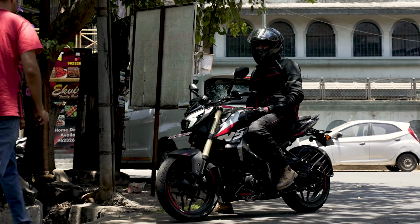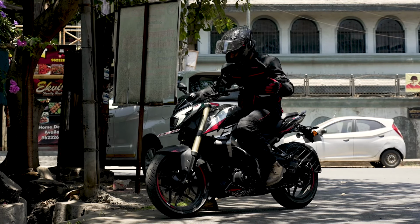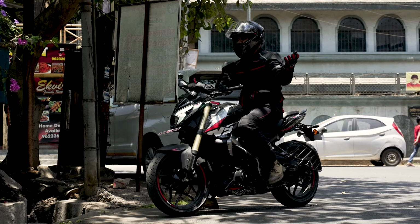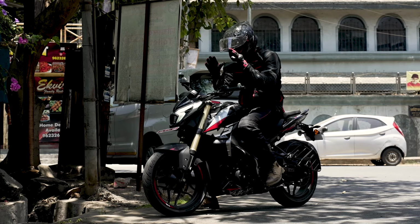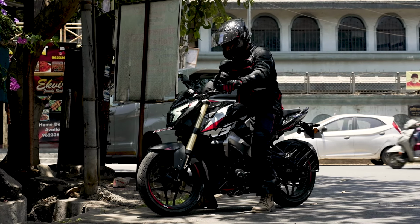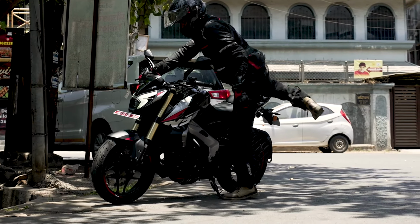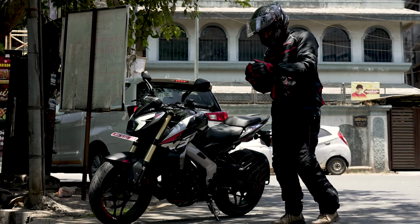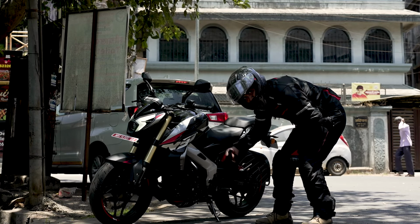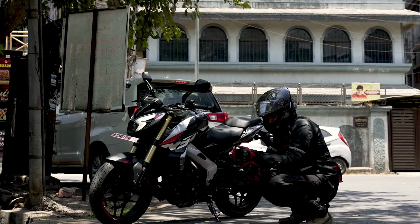Finally, let me talk about the negatives that this bike has. So when I was pushing it in Ambi Valley, I realized that there was an overheating sign continuously coming on the NS400Z. Then it all came into reality when the engine suddenly switched off. It was not starting and it showed all the signs of an engine overheat, which was quite baffling because I did not use the Pulsar so heavily that it would reach that level. It somehow unlocked another thing called the limp mode, where you are not allowed to rev over 4,500 RPM